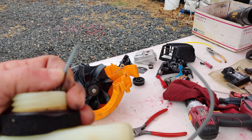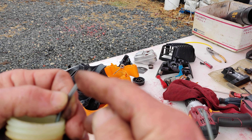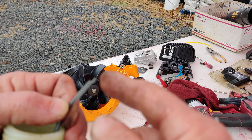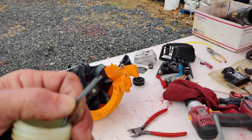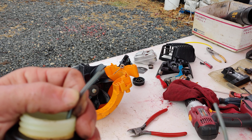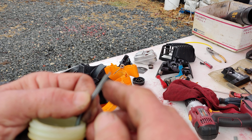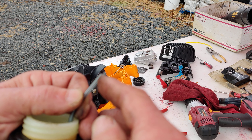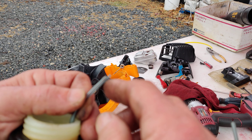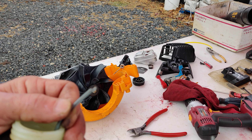This is the side that goes into the carburetor — the main fuel line. I'm going to have to trim this back to normal and then put the fuel filter back on it. I'm using the original filter — I cleaned it out and blew through it to make sure there were no restrictions. The problem I have is trying to get that fuel filter on — the original hose was bigger at the end where it fastens onto the fuel filter. So what I normally do is take my Bic lighter and just heat up the line a little bit until it expands enough to get the fuel filter back on.